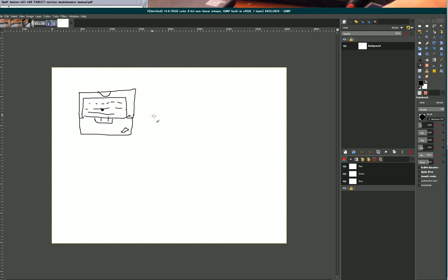Okay. So, the way that the palm rest attaches to the bezel, the upper bezel piece extends down. So here's a side view of the laptop with the keyboard up top and the hinge up here now. And the charger's on the other side on these. So I'll put the ventilation fan here so you know where I am. The bezel just runs along the top like this and reaches down to the bottom of the keyboard, and then there's this teeny tiny little hook thing on the X200 series, and on this one, but only on one side on this one. And the palm rest lies down on top of that hook, and that's how they're anchored together. And that hook is tiny and always breaks.